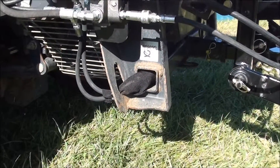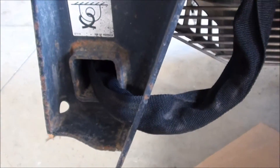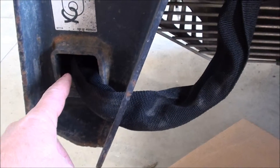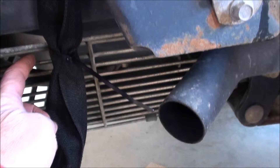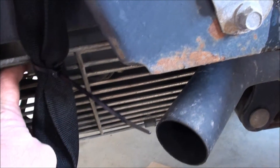Route the long pair of hydraulic lines from the selector valve through the tubing as shown, coming up through the hole and bracket to the passenger side cylinder. Zip tie these hoses to the radiator cage.